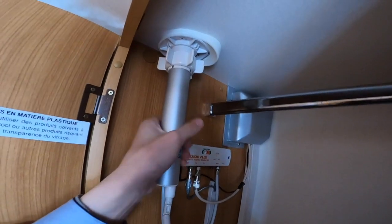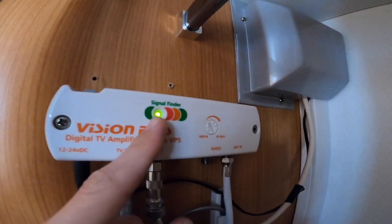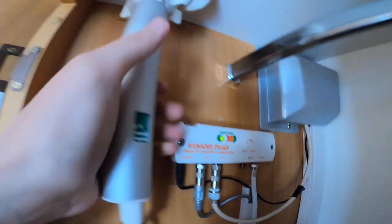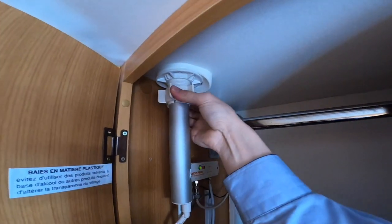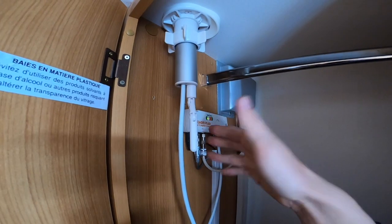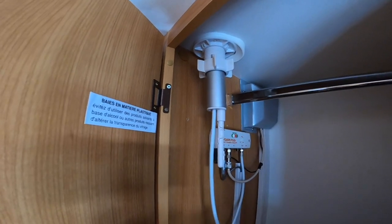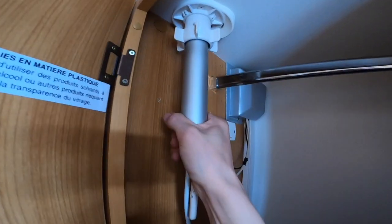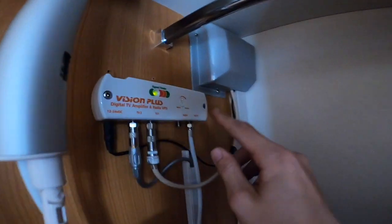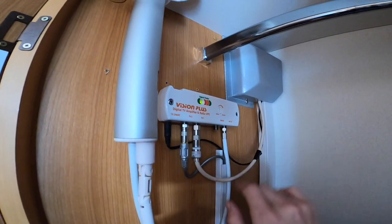You've got your Status TV aerial. When you get a green light it means it's found a signal; if it's orange or red, the aerial needs to be moved. Loosen the nut, push the aerial up, and use the toggle to direct it on the roof. A good tip is to point it in the direction of other motorhomes and caravans on your site. When travelling, pull the stem in and securely fasten the nut to stop the aerial being ripped off by the wind. You've got a min and max signal booster control to maximize or minimize the TV signal as needed.